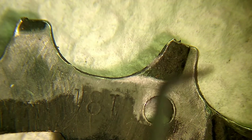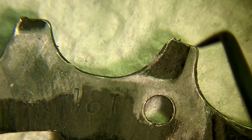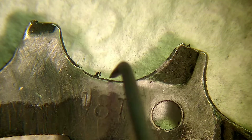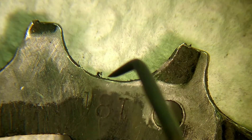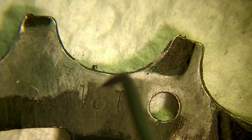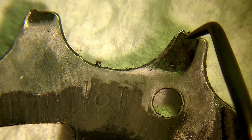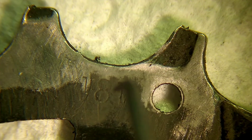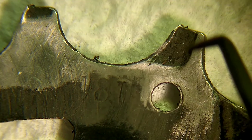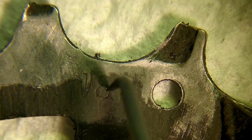I made sure my index was fine and my cable wasn't stretched — everything was working fine, my index, my tension — and I couldn't figure out what it was. The cassette didn't look worn; it had only been about 500 miles. Yet it continued to have shifting problems. This was the gear giving me the main problem: the number 18 and the 15 right below it. The 11 and the cog above the 18 were not giving me problems. It was just this one, and it was when under load.